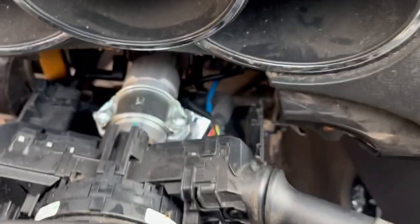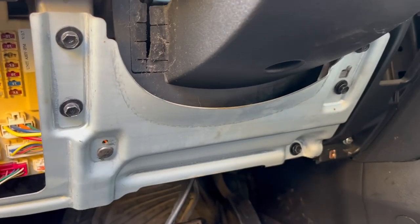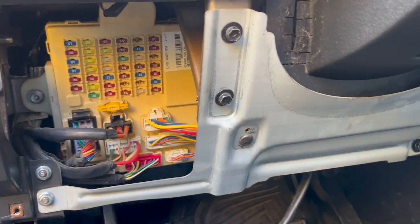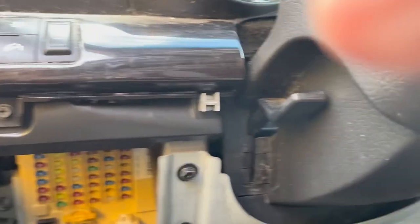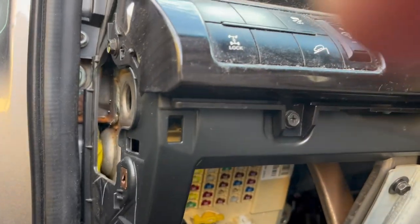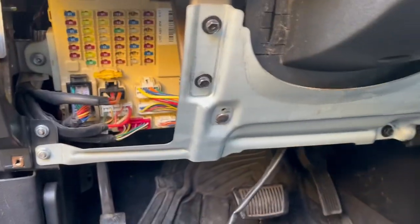Success — it's in now. Let me walk you through how I got to that point. Take that plastic covering off and underneath there's a little plate. There are just a couple of miscellaneous little plastic pieces — that little plastic dash covering has two screws on the side and a little clip you've got to pop free, and then two Phillips screws down there that go into it.